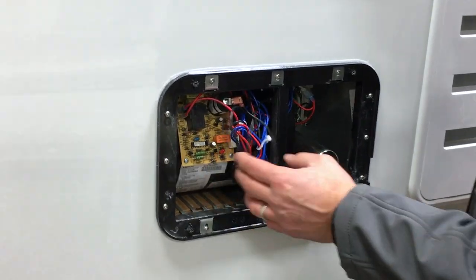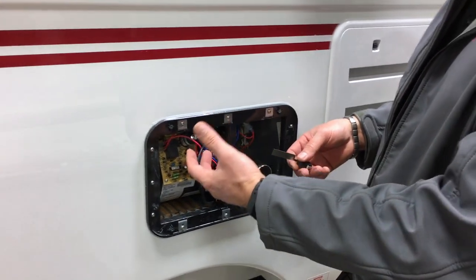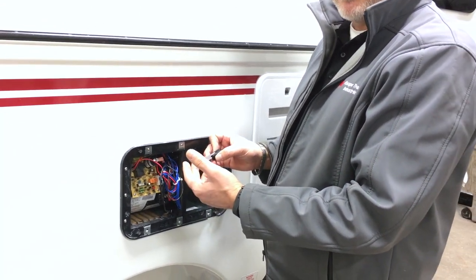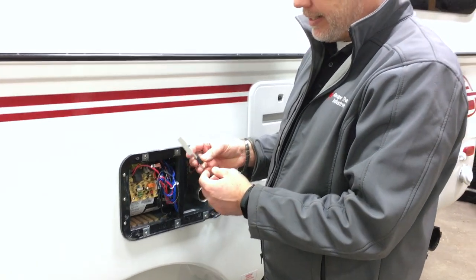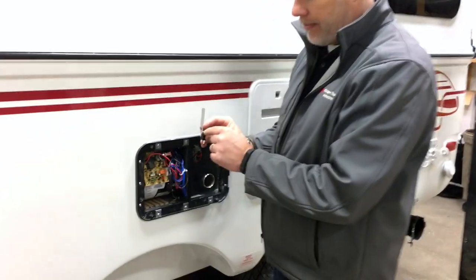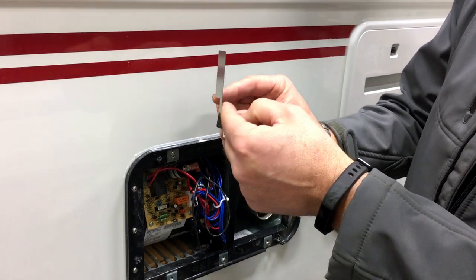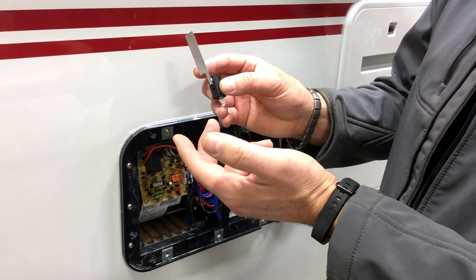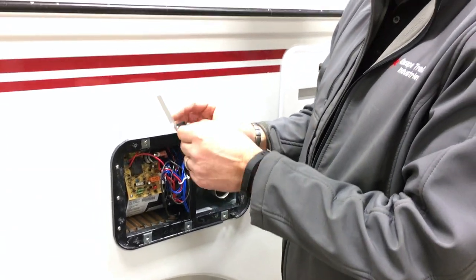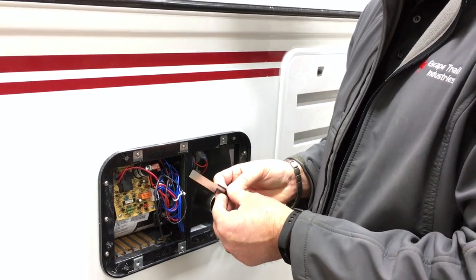The sail switch is probably the most common failing part on here. One of the reasons is that the sail switch mechanism is right in the fan which draws your inside air — it recirculates inside air — so it can pick up dust. We've quite often seen when you take these out there'll be a little lint string coming off the end of that little white switch. With a pair of tweezers, we've seen where you'll pull out about a half inch of lint string, and then it's working fine again. If that's the case, just clean it, put it back in, and you're probably good to go. But you might pull it out and it might break off inside — it might work but be a temporary fix — in that case you'll need to order a new one.